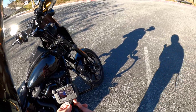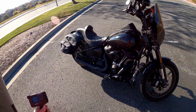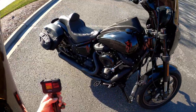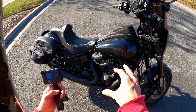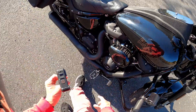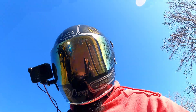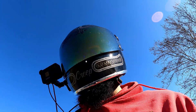It's just a follow-up — over a thousand miles now. As you can see, all the oil — the red oil — has now been oxidized, evaporated, or it's seeped into the filter. It's no longer red; it's lost its color. It's now that dark gray-looking air filter. You don't have to recharge this for another 30,000 to 40,000 miles — that's what's recommended.